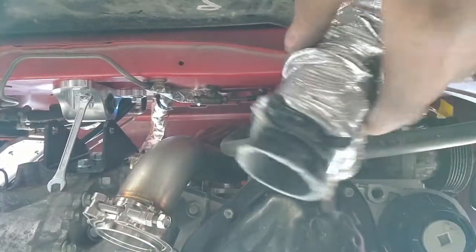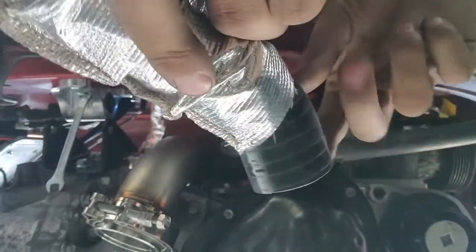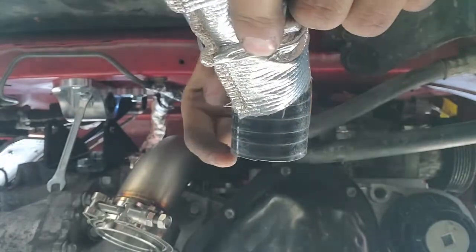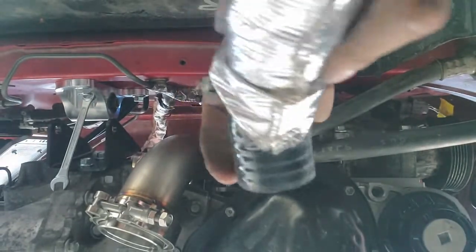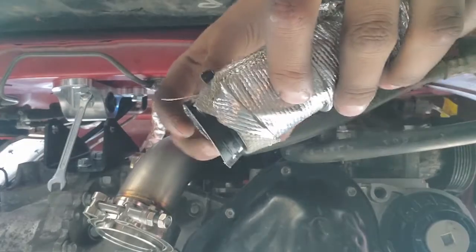You don't want to install the front mount bolt just yet, as you want to push the engine forward as much as you can to get enough room to install the coolant hose. I just wedged a wrench between the motor and firewall to keep it from realigning and closing the gap.